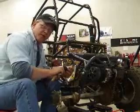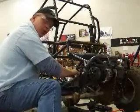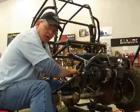First thing you do is take off the variator fan. In order to do this you'll need an impact wrench and you'll have to hold the fan. Some of these you might have to wear a glove — they can be really tight from the factory.